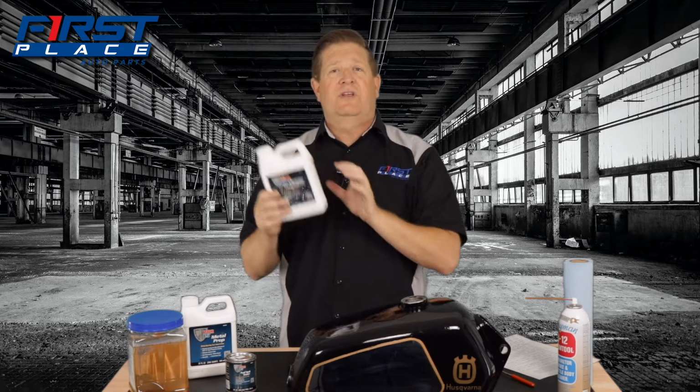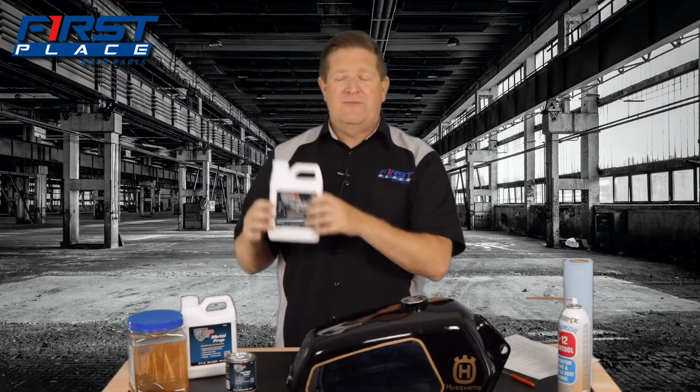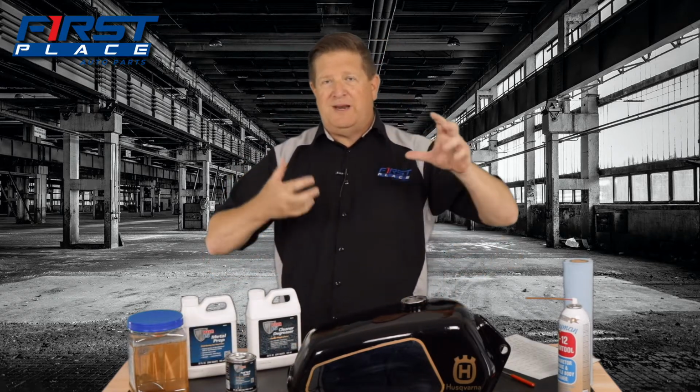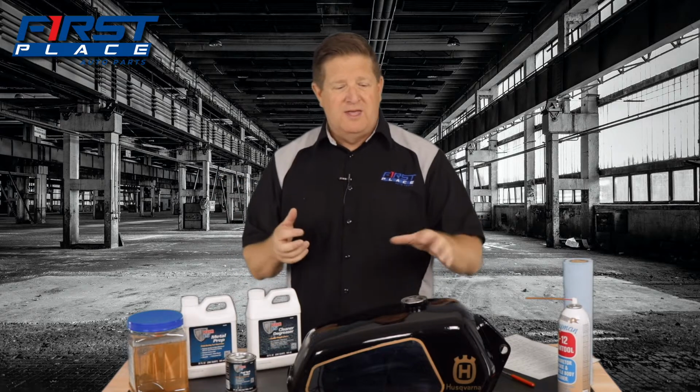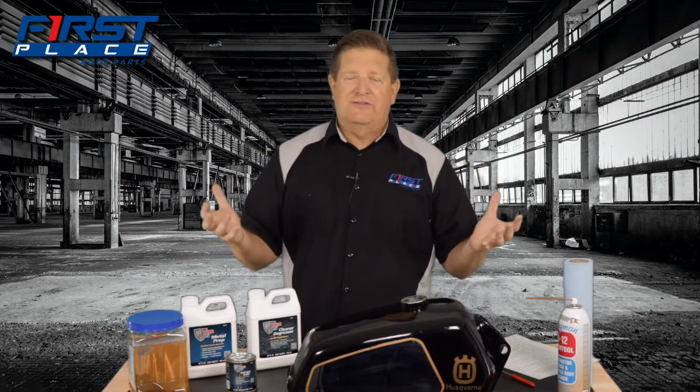So just use this container after you've dumped the degreaser into the tank, fill it up with water, and that's the correct amount. Pour it in there, and what you want to do is slosh this tank around. You want to keep it agitated, moving back and forth. Again, make sure everything's sealed, check for leaks, try not to get any on you, and do it outside.